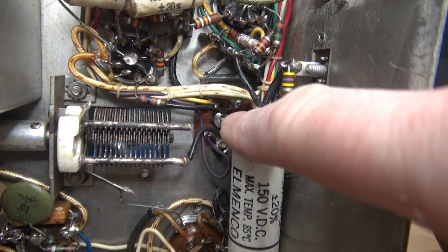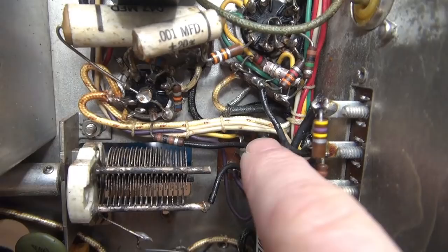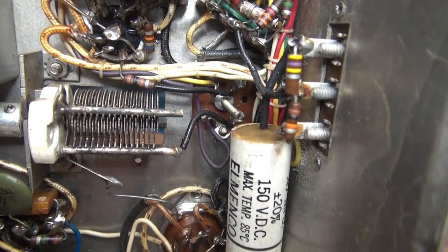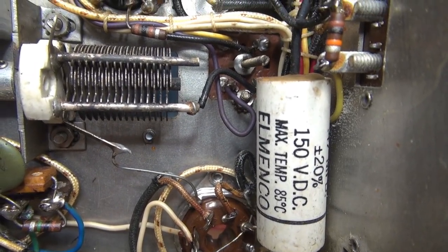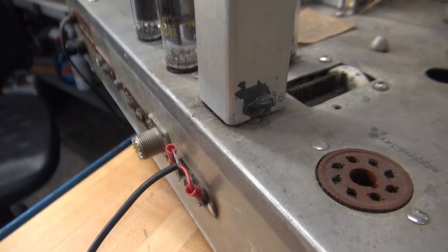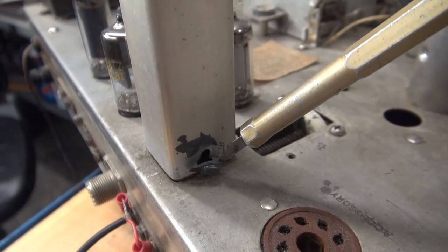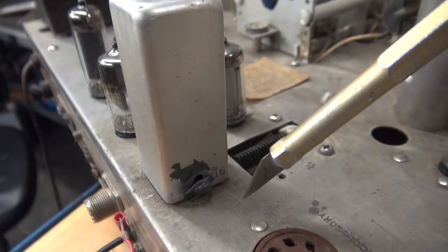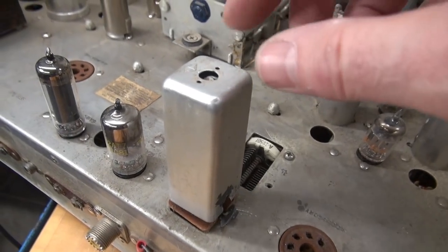There's that little adjustable can in the back of the radio. I can see what the problem is — there's a nut missing. You can just barely see it under the harness there. The nut's gone and it got hit. This one is actually bent up and it appears to be touching those terminals. I hope it didn't do any damage. I'm going to repair that first and then we'll try a power-up. The plot thickens — I thought it straightened out pretty easy, but it's actually sheared out of the can and somebody tried some JB Weld. That's probably what the tie strap was holding.